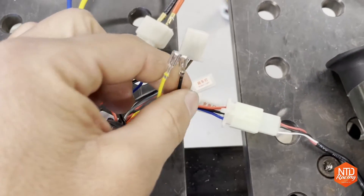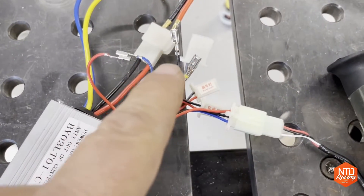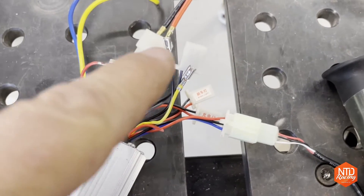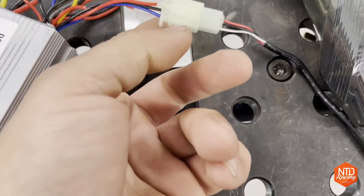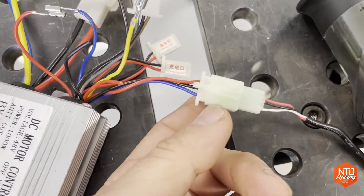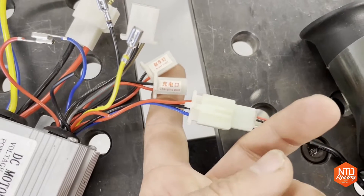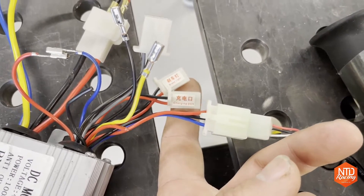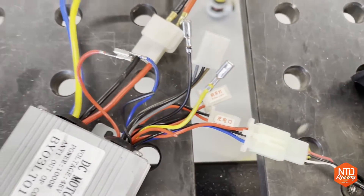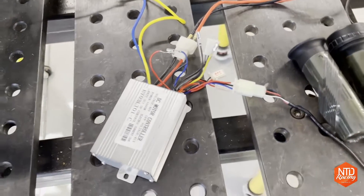On this particular controller there's another switch with a yellow and black — I've heard it can also be green/black, but in this case it's yellow and black. This goes to the safety switch on the brakes. Besides that, it's pretty obvious: you've got three wires for the throttle hookup, a couple more wires if you want to charge, and we're going to use the charger that came off the side of the battery for charging. There's also a brake light connection.